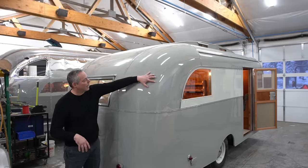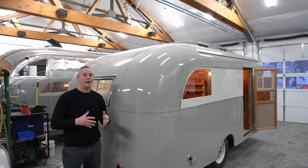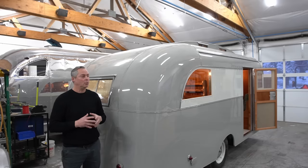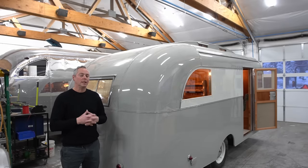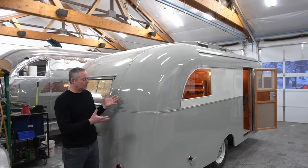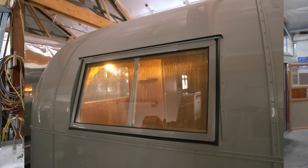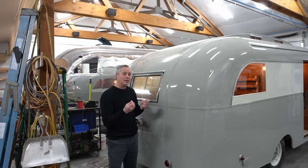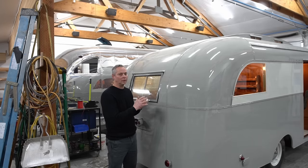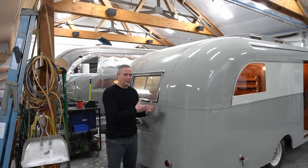These corners here are actually a formed fiberglass corner instead of a hydropressed steel corner that would have been done back in the 30s and 40s. Very time consuming, but we got a perfect fit and it's nice and smooth. Because of the gel coat and the paint, like you would do on any fiberglass, we were able to get it extremely smooth and very durable. It looks the part of what an aluminum or steel corner would be. Let's talk about the copper screen — check this out. Look at the glow that that gives you. That is period correct for the 30s. A 1938 trailer would have had copper screen just like this. It's a real thick material, super durable, and it just gives it that beautiful glow look. All these little things add to the period-correct 1930s feel of this two-window Westcraft.